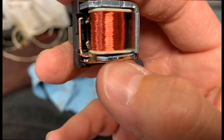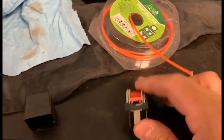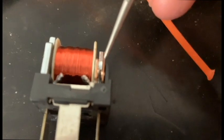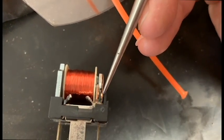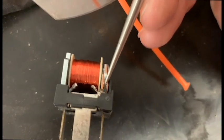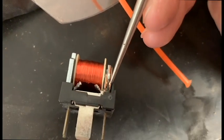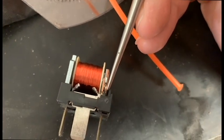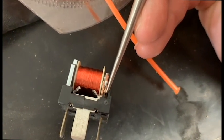Most times inside, the terminals burn. Those are round terminals — the little round terminals right there are the electrodes. That's what touches and makes power. Sometimes you can clean those up with sandpaper as a test and get the relay functioning again. Sometimes they're melted to high hell. Most air compressor relays, they close and they melt, and it burns that compressor up and then blows the fuse in automatic suspension cars.